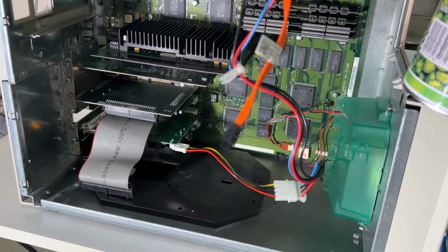It's really annoying, and in the case of Newertech, their drivers actually kind of do an end run around this and allow the card's L2 cache to work if the motherboard L2 cache is inferior, which in this case it is. So I don't have to do any modifications, and that's kind of why Garth said, hey, if the Max Power works better in that machine, feel free to use that and just give me the Interwear card, because I'm not sure if the Interwear card has any drivers. I've not found any for this machine. And if it does, I'm not sure if they address that issue.